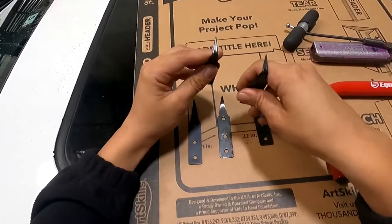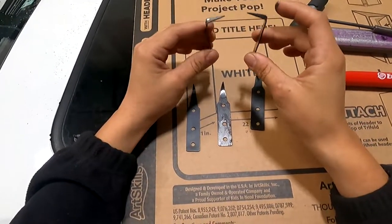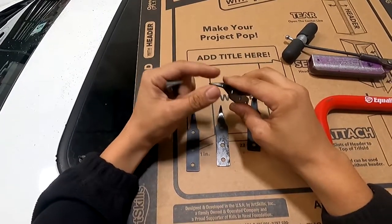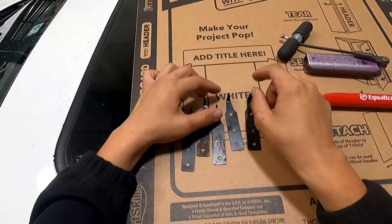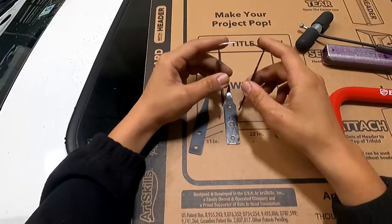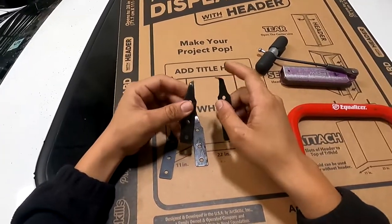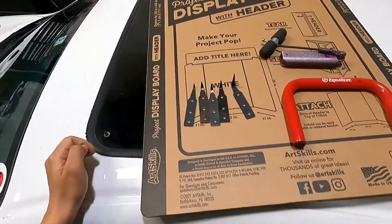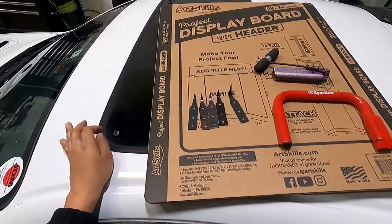It's very important to show you that it is important to keep your blades sharp. This is a new blade and this is a used one — you can tell the difference in how they feel. A lot of the process of cold knifing a windshield is not about how strong you are, it's about how sharp your blade is. Your cold knife will be doing the work, not you physically. If you're doing a lot of physical work, it's because the job is really tight or your blade is dull — as soon as you sharpen it you'll be able to tell the difference.